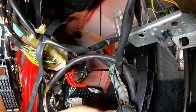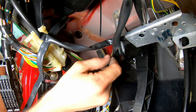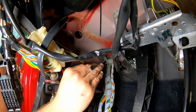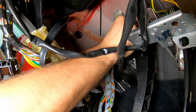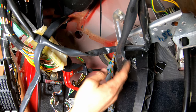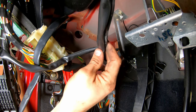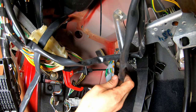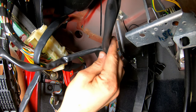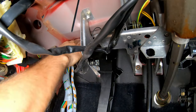So now this is all disconnected, at least the top one. This wire right here is extra - this one's broken, probably something someone else put there, that's not stock. Let's get that out. This wire right here is to the auxiliary lights - the two I haven't had in the front. So this is actually extra equipment. Now I have one extra piece of equipment on this car. Let's push this harness out.